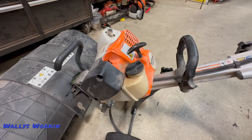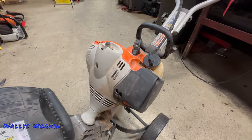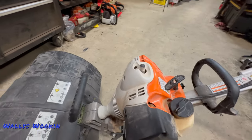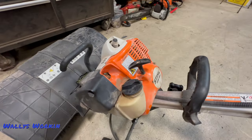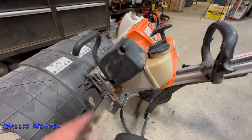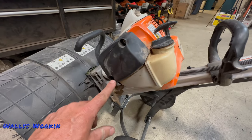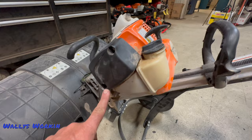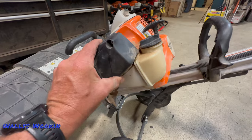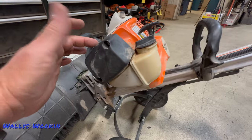As far as the outside of the engine goes, everything holds up quite well. The gas tanks are really strong. The engine housings are fine — if you bang it into something you can crack the recoil housing or front housing. The air filter covers — you want to make sure the screws are good and tight, but do not over-tighten these since they go into plastic. I prefer to use hand tools when tightening these, because they will loosen up over time and fall off.